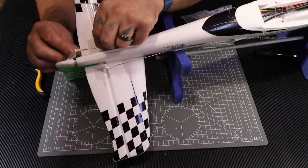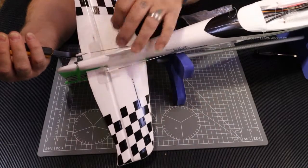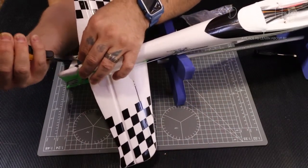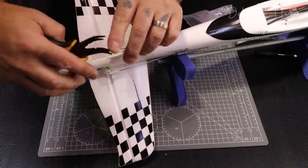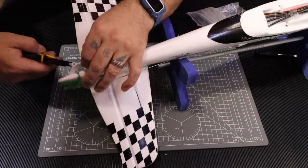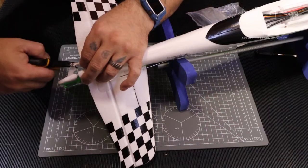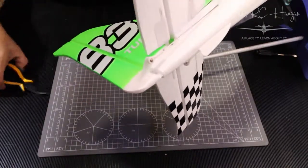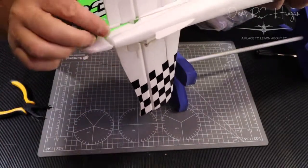So once again, we put the hole over the ball, put our tooth on the ball underneath around the circle. Oops, sorry. Get that on there. No, this doesn't want to do this that way. Maybe it'll do it the other way. So you want the actual tooth part on the underside of the ball, and then push, these two sit either side, and if I can get it on, there we go. It's a bit fiddly, that one, don't know why. Then it fits on there like so. All it's doing is holding the outside of the plastic ring and popping it onto the knuckle.